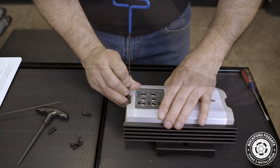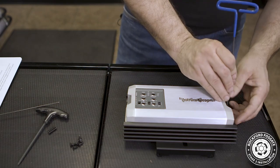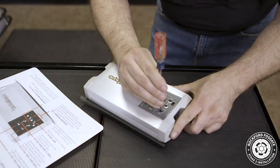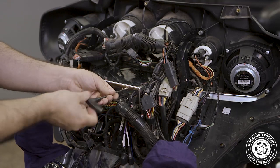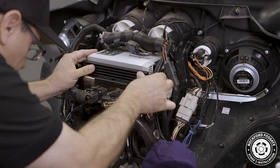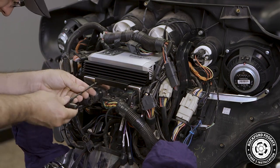We'll flip the assembly over and secure our amplifier in place with four button head screws using a 2.5mm Allen. Once we're done, we'll tune the amp. Now, we offer this free amp tuning guide that's available in the description of this video and through this kit's product details page at rockfordfosgate.com. Once we get the amp configured, we'll use a T10 Torx to remove two screws from the back of the source unit and secure the assembly to the top.